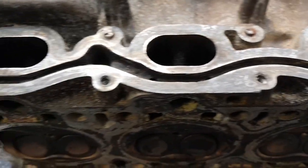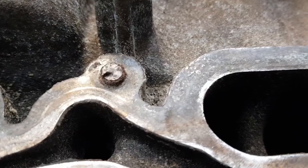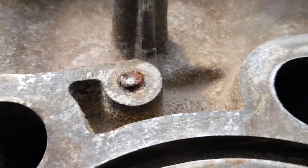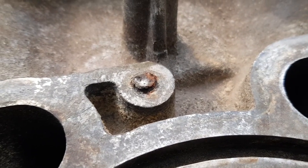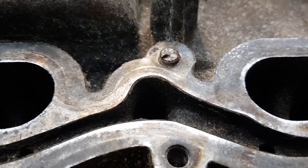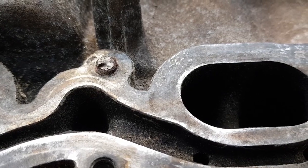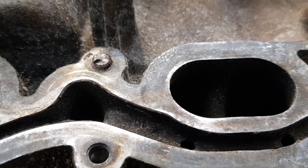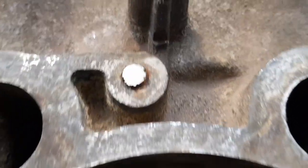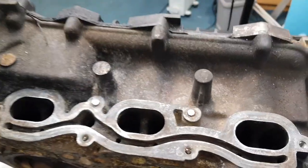The surface is now suitably clean for mounting the jig on, so it'll sit nice and flat. If you look closely at these two snapped studs, you'll see the ends of them are not very square. Since we'll be drilling into the centre of these, it's very useful to have a nice flat surface on the end. So I'm just going to use an angle grinder to dress the ends to make them flat and parallel with the face of the head. Here you can see where I've cleaned up the ends of the two studs.